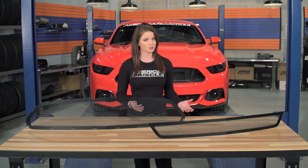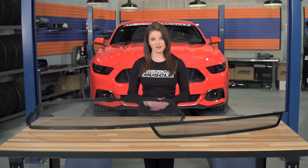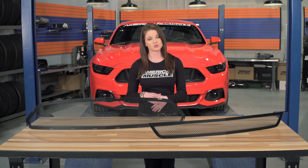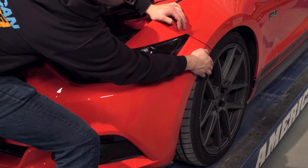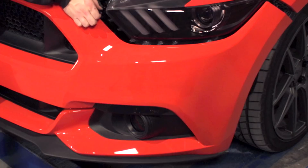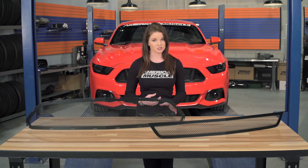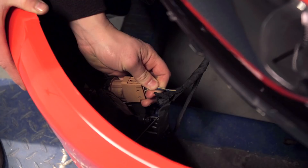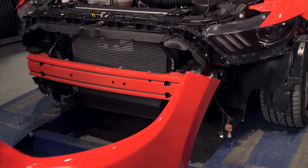You do need to remove the front bumper, so you can start by popping out the eight plastic clips that are holding the black plastic cover shroud. You can use some painter's tape at any time just to give yourself a little protection around the work area so you don't scratch paint or mark up the shroud. On each side of the bumper, you'll need to back out the screws that are holding the bumper in place as well as the plastic clips that are on each side of the front tires. After that, there are about 12 screws on the bottom of the bumper overlap that need to be backed out. Then you can pop the fascia off by pulling the sides near the front corner lap right underneath the headlight, but just make sure to unplug the headlight connections before walking away with the bumper. You will be laying the bumper face down somewhere to do the install, so lay it on some protection so you don't scratch it.